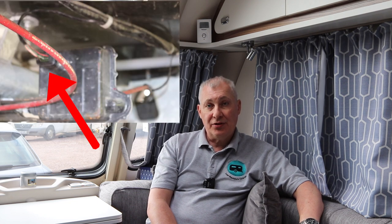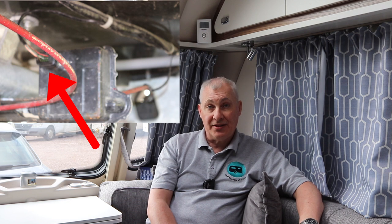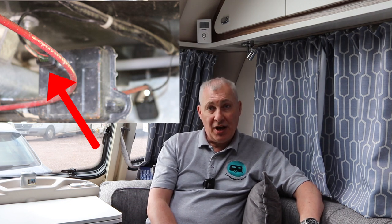The engineer arrived about a week later and did exactly the same checks I've just shown you. Sadly the ATC was still not working, so the next stage was to crawl underneath the caravan and loosen two 17mm nuts located on the push rod itself, which freed the brakes up. While underneath, the engineer noticed that the electrical plug socket for the ATC wiring was loose. He pushed it back into the socket, located the two spring tangs that hold it in, and the ATC sprang into life and began to work.